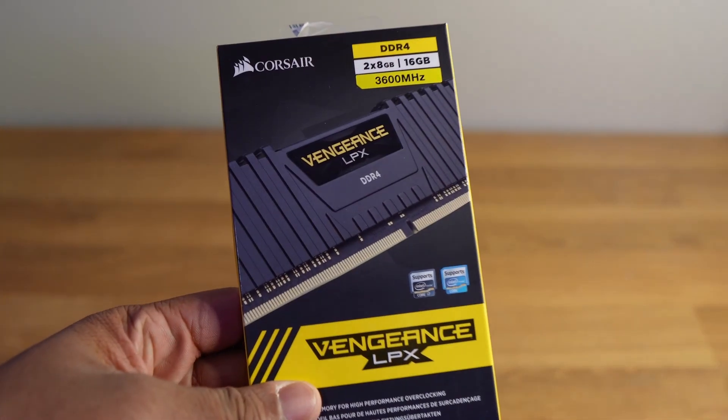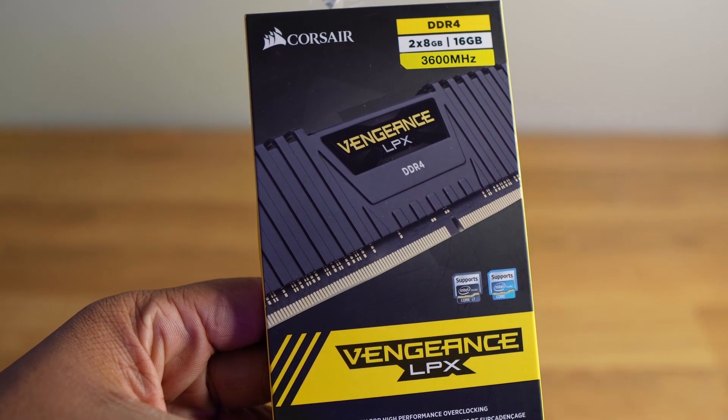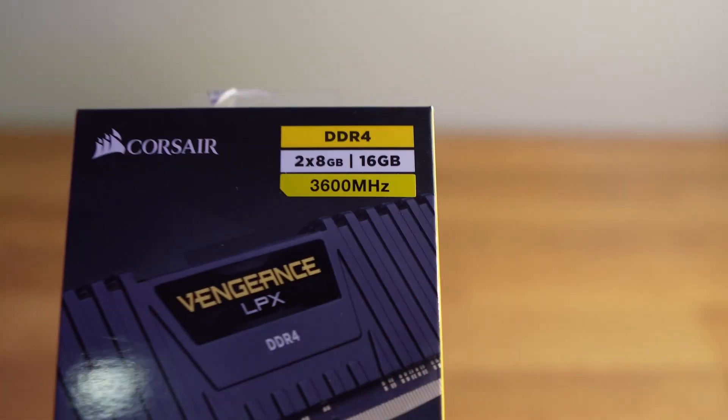Generally speaking, if you want to save some money, you should get a Micro ATX board, and as long as it runs the whatever processor you're running, it should be good. Next up, I have 16 gigs of RAM. I probably could have gotten away with 8 because it's just going to be a NAS, but I went for the 16 because it was on sale. I'm pretty sure the speed doesn't matter in terms of file server use, but generally speaking with Ryzen processors you're going to want faster memory. In the case of a file server, you would prefer to get ECC memory — something you'd have to make sure your motherboard supports. My budget motherboard doesn't support ECC, so I just got a DDR4 kit and 16 gigs of memory.